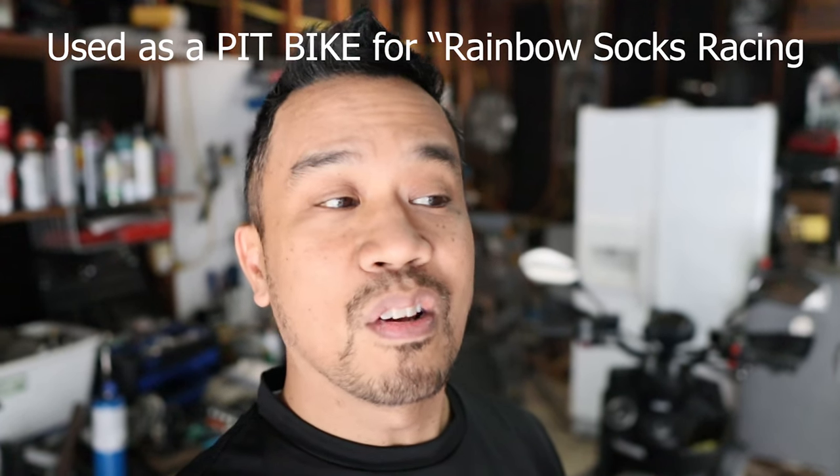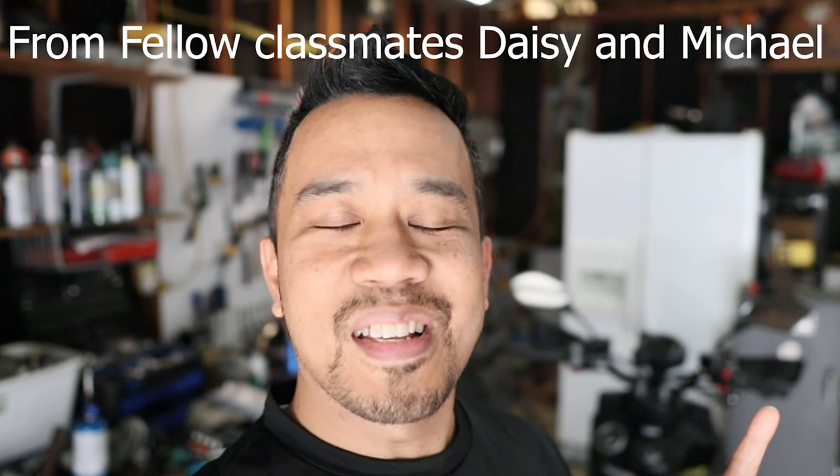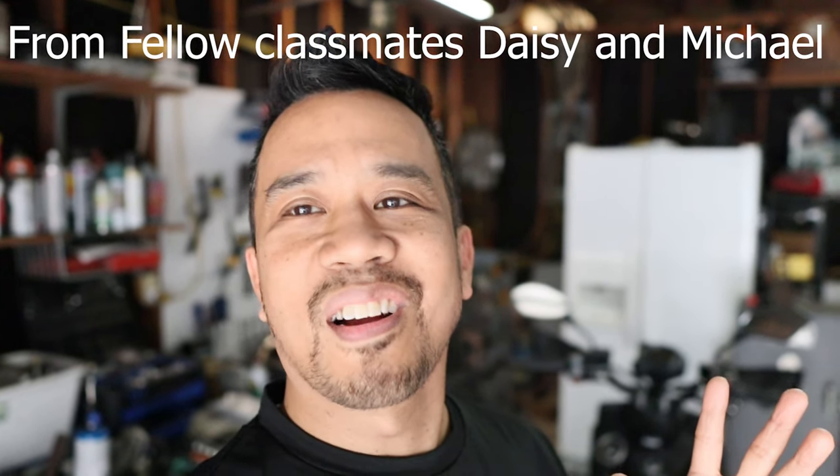A little bit of history: this ruckus has probably been sitting idle for over a year, maybe two years unstarted, so it looks like the jets are stuck. The video before this, I was doing a fuel pump replacement, and after I got the fuel pump in, it didn't start. It would turn and pump fuel, but it never actually started. So in the middle of making that video, I'm making this video.